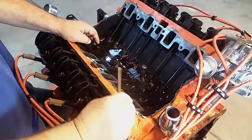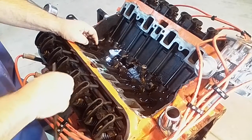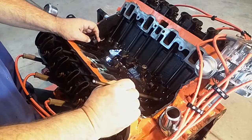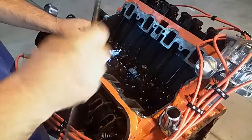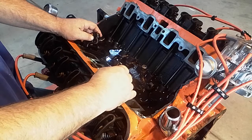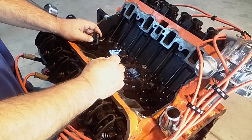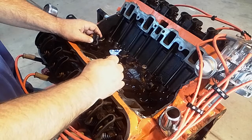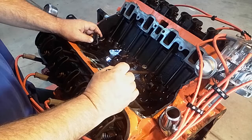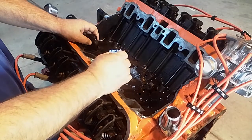Now, a lot of times to test a motor, I'll roll it by hand, you follow the firing order, and you go through and see how loose the rockers are. This motor's been sitting 2 weeks, and these are all still nice and snug, and the lifters haven't pumped out. And that's another thing to consider, is what is the lifter? If you're getting rocker noise, it is either the bore worn to where the lifter can't hold the oil in it anymore, or did you go to a different type of lifter that might be a slight bleed down lifter? Some of these lifters are not designed to hold the pressure that well in there. At low RPM, they bleed off some. An extreme example of that would be a Rhodes lifter. They're meant to bleed a lot down, and you will get rocker noise if you run that kind of lifter. So the question is, what lifter is it?